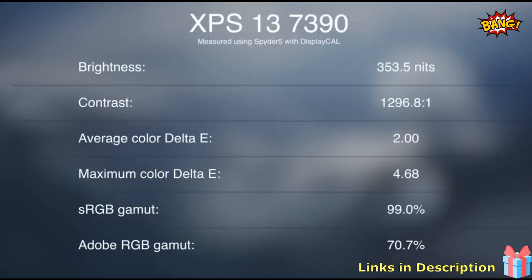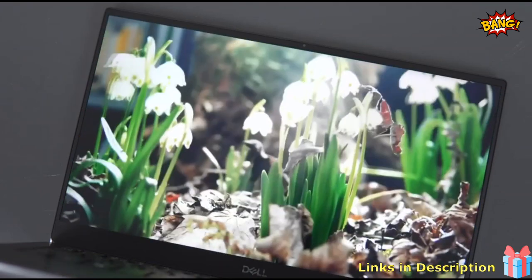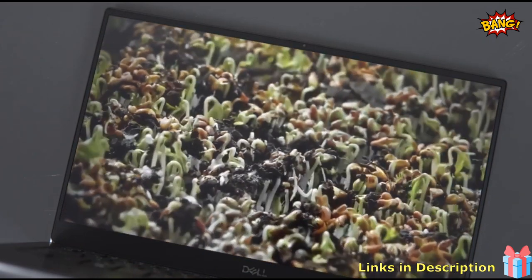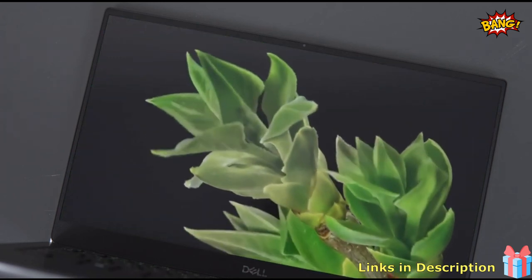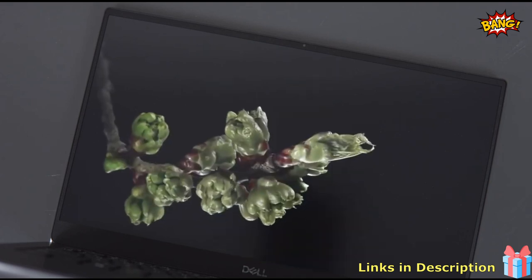The unit I'm reviewing comes with a 1080p screen. Image quality is excellent — A+. I consider 1000:1 contrast to be good, and an average Delta E of under 2.5 is considered perfect color accuracy, so imperceivable to the human eye. However, the brightness isn't as good as the MacBook Pro or the Surface Laptop. 280 nits is the minimum and most common among mid-range Ultrabooks; 350 nits — which this laptop achieves — is very comfortable indoors; and 450+ nits is usable outdoors, which those two competing laptops achieve. If you are a content creator, I would still point you towards the 1080p screen unless you need the brighter display. They did an excellent job here as far as image quality and color accuracy.